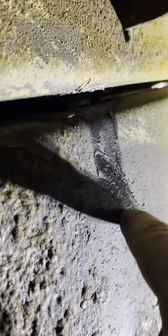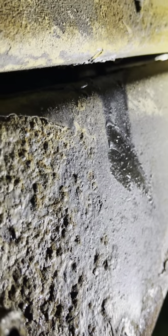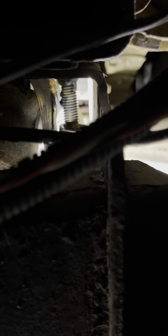This car is almost 20 years old at this point. I plan on driving her until she falls apart. That's how you do this. You should not need to remove your tank if you can figure out how to safely remove that third bolt. You could use a Sawzall, or you could probably use an angle grinder and cut through here — just be really careful not to damage your car frame, and be careful not to blow yourself up with the gas tank. If you have a gasoline vehicle, take the tank off, get all the fumes away, and have this thing safe. Don't touch a spark anywhere near a gasoline tank.